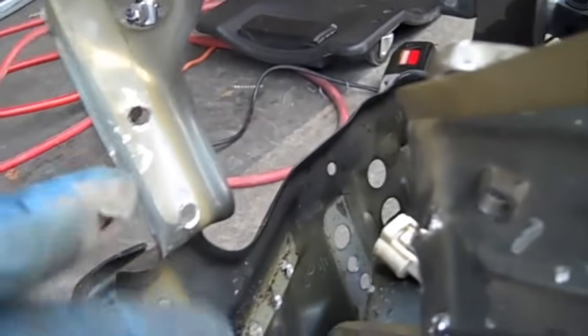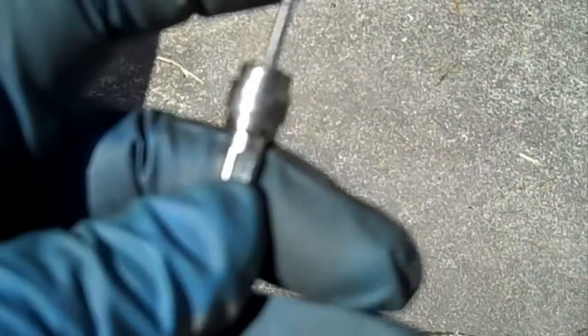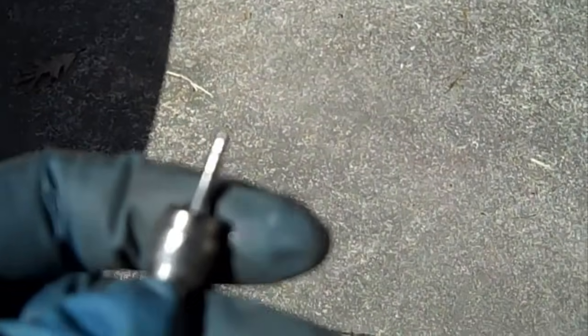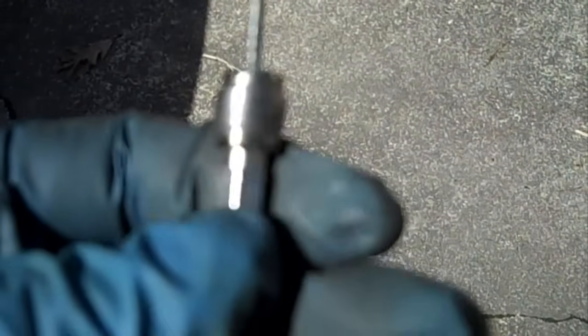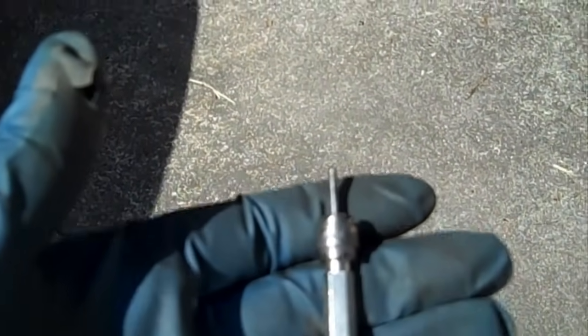You'll walk it all the way down wherever they've put the bent flange right here, and it basically just butts against it and spot welds. This is a spot weld tool — there's a little blade right here, and it's spring-loaded. You can either drill a decent hole for it to center in — about halfway through — or drill a hole all the way through. As long as it centers, this little blade will eat around that spot weld. This was my last blade and they're dull, so it may work, but I've got at least ten welds to drill out. This is what you'd want to use if you want to do a really nice job — that way you don't have any holes on the flanges.